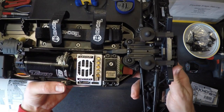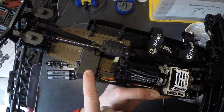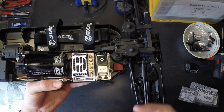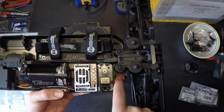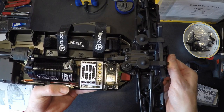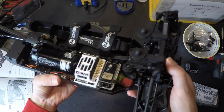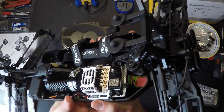Normally your transponder is in the back, but I've moved mine up front. I've had this happen where I've had my transponder up front and crossed the line about an inch behind somebody else in a competing vehicle — and I've won, because their transponder was in the middle of their vehicle. So transponder position at the front of the car can actually give you a competitive timing advantage at the finish line.